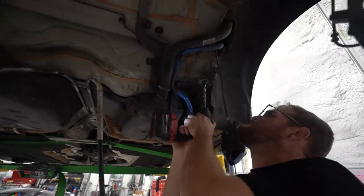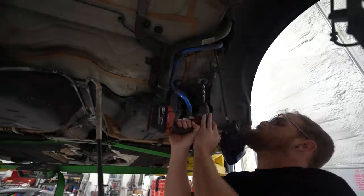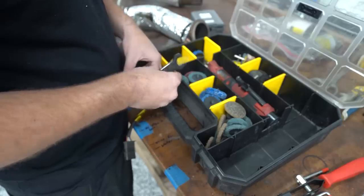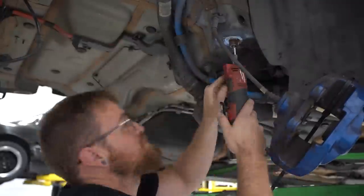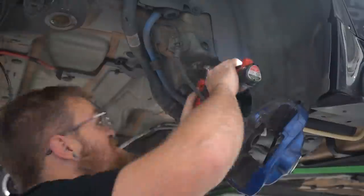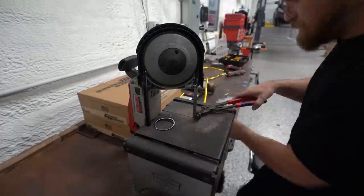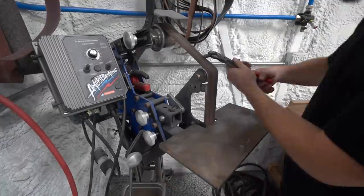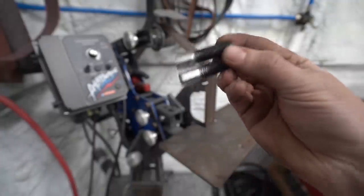The first bolt snapped off deep but this second one snapped right by the bolt head, so I basically just had to drill it out enough to get the shank of the bolt to go in and locate well. We drilled as much as we could but since the hole was a little off center — which is what makes drilling bolts out tricky — we went as far as we could, then used a carbide burr on the die grinder to work out the sides and open it up enough to slide the bolt in. We're going to TIG weld this so we have good control and can keep the weld bead as small as possible, so we need clean parts.